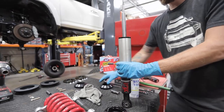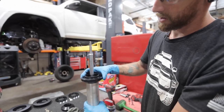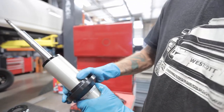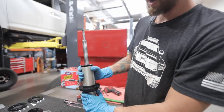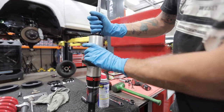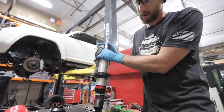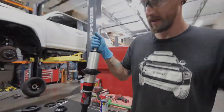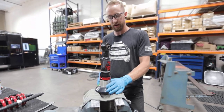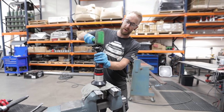To install the new collar, spray a little bit of lube on the body of the shock. Make sure your spacers are tight together. You can do this one of two ways: you can either put it in a vise and use the mallet to push this down, or we can take it over to our press. Let me show you the vise. Now we're going to show you how to install the spacer on the strut using a vise. Put a little bit of lube on it and just strike from the bottom of the shock.